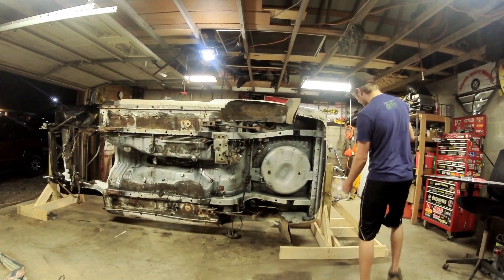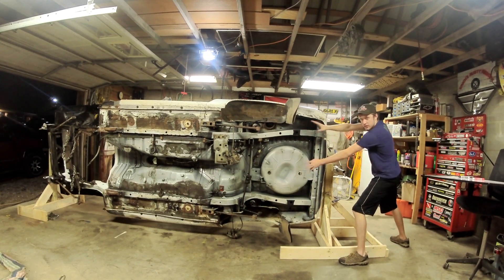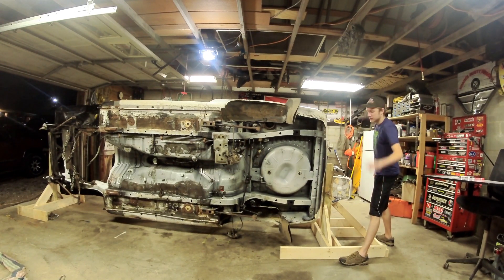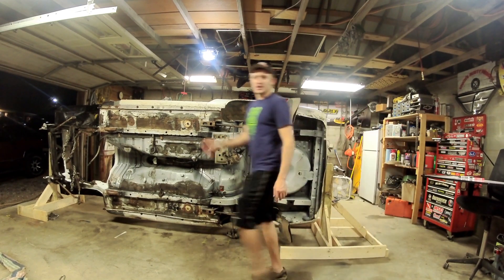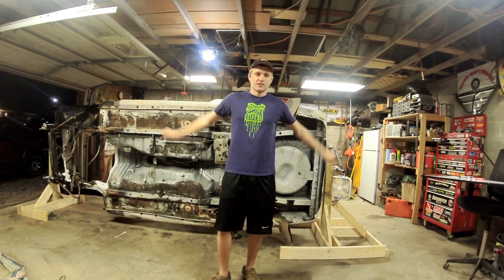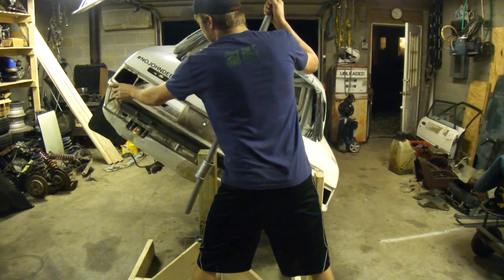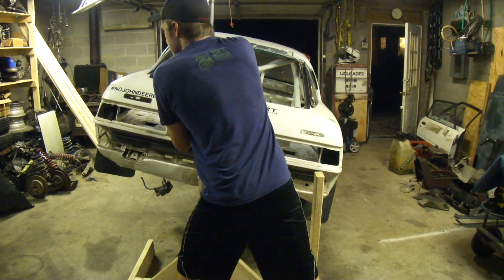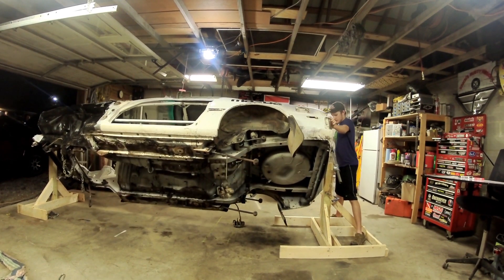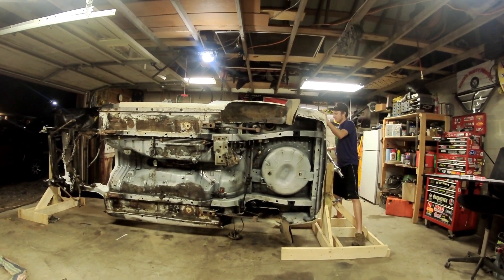I built this whole apparatus in order to keep it from falling over when I try to push it this way. You might think a big rectangle provides rigidity to the system — actually it doesn't. The only two touch points your car has to the ground through the rotisserie mean the rigidity is applicable whether the car is on its side or vertical — it's still just as rigid.